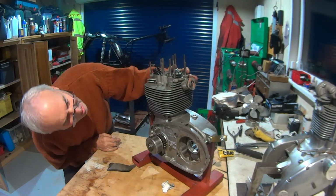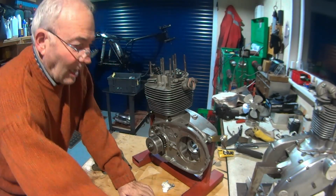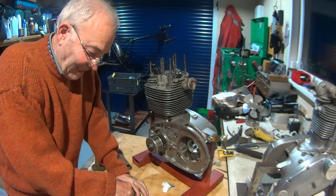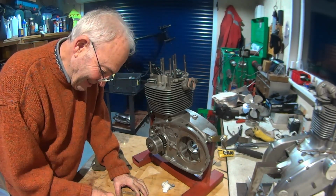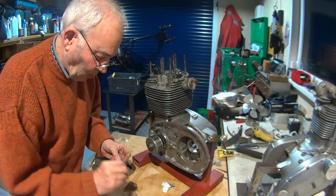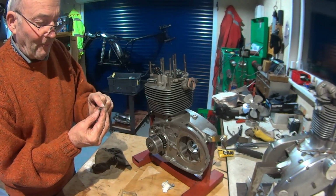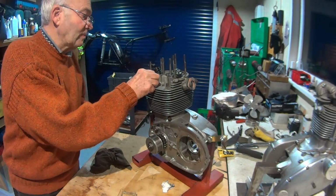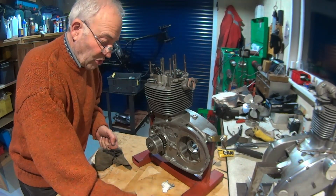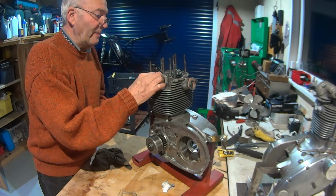And we down. Yep. So I have cleaned, I did find the cylinder head nuts in the end. They are, not saying these special washers, but they're very thick washers, because obviously you're pulling down on a soft material, so you want to spread the load as much as you can from the nut onto the soft aluminium head.